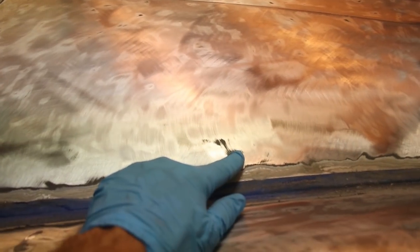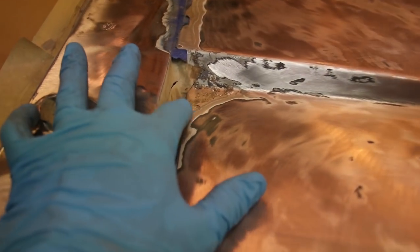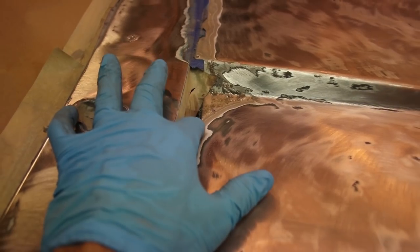After that second round, I don't see any more stains in the metal. It's those dark maroon stains that I feel are not good. Now I have shiny metal, or sort of blotchy metal. I'm reasonably confident now that the contamination due to the acids of the paint stripper are off the hood at least. That's the process - I'm going to keep doing that. Next step is to get the 80 grit DA sander and remove all the last little bits of paint. That's going to come off and it's going to get that mechanical tooth to it. I also need to find a tool to get into that corner because none of the discs could reach there.